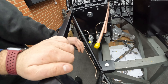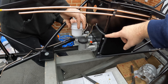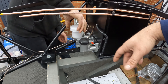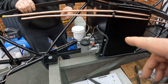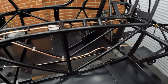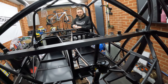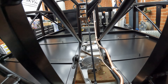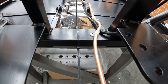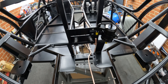Rob is winding in the reservoirs now. You also need to make sure to cover the brake pipes, as stated in the manual, with some split ducting, just to stop damage should the prop flick anything or bang during installation. We did our fuel lines at the same time as the brake lines, since if you're going to be drilling, some of them actually run together along the bottom. We've got our fuel filter fitted here too.